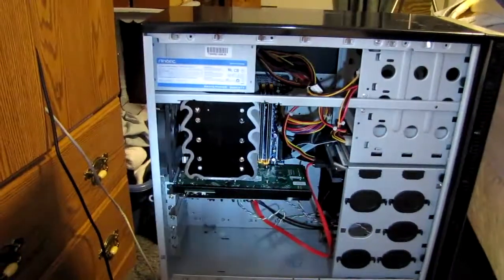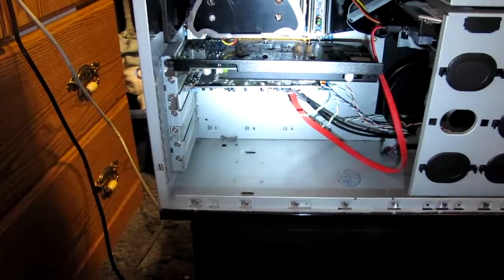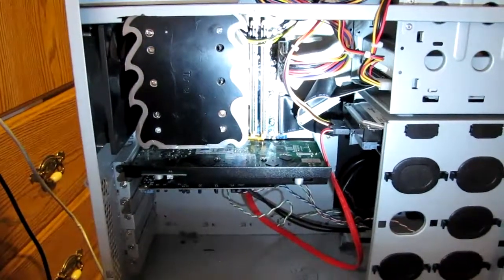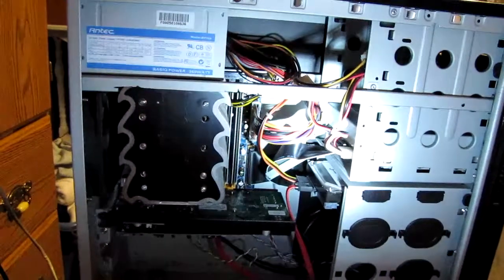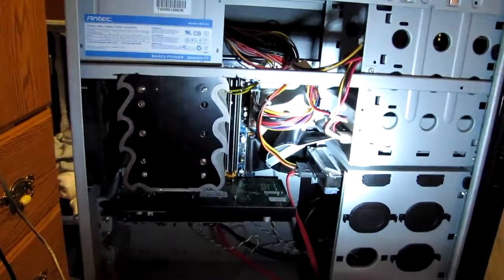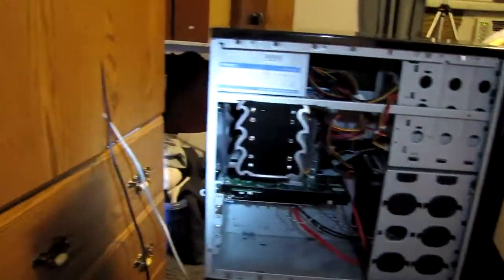Finished. That hard drive in there — that's a 120 gig Seagate Serial ATA. Tuniq Tower, our GeForce 9600 GSO, and right underneath that is a Sound Blaster Audigy SE PCI. Two sticks of 2-gigabyte OCZ Fatal1ty DDR2 800. That's an Antec Basiq 350-watt power supply — no name. I think it's a Lite-On DVD rewritable drive made in 2003, so it was seven years old, not six. And all this in an Antec Solo case.